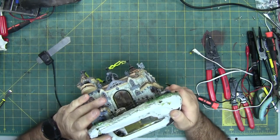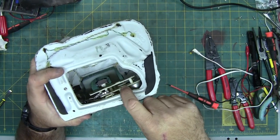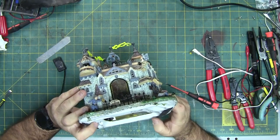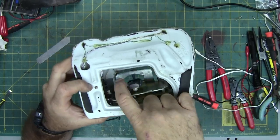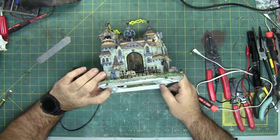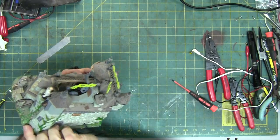Here's the entire mechanism — right there. There's your motor, there's your gears, and there are some wires that run it. You have two wires to the motor. There is a micro switch right here, and there's going to be one on the top too — that tells the motor to turn off so it doesn't keep turning and break everything. If you're having a problem with that, you're going to have to replace your micro switch, or you have a bad circuit board that can't read the micro switches.